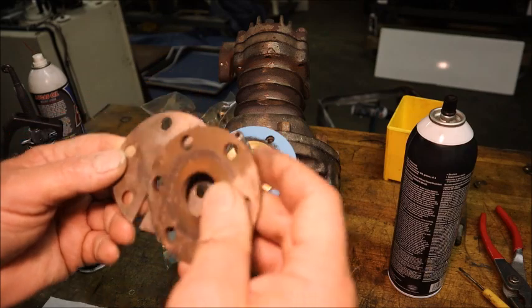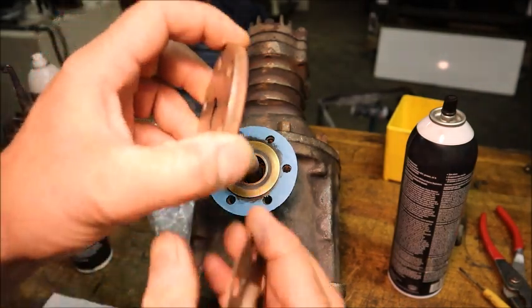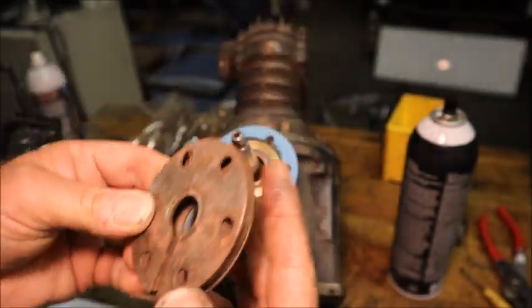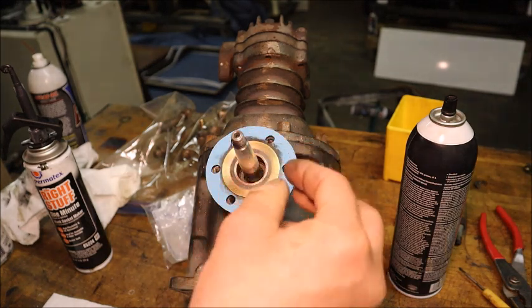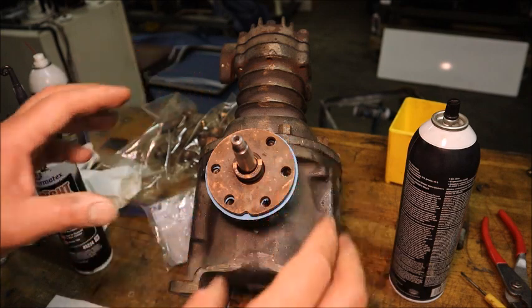This shim has a slot in the bottom that forms a drip path — so when oil slowly comes out it will exit through the slot. This one has a tab below it so oil will drip on that and run to the back — it's supposed to keep oil from falling on the flywheel, which would cause it to get thrown around and be suboptimal. Then there's a shim and the tension spring that keeps that seal pressed together. This plate clamps everything down — it clamps the seal and the gasket together.